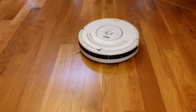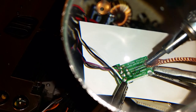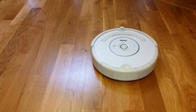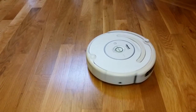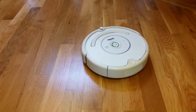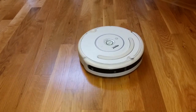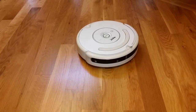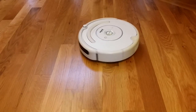Today on Microtux, fixing Roomba Error 9 and the Circle Dance. Our old Roomba suddenly refused to move forward — it would only go backwards and in circles before finally stopping with Error 9. The solution is to replace the IR LEDs and the phototransistors in the bump sensor, which will cost you less than $6 in parts.